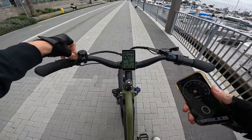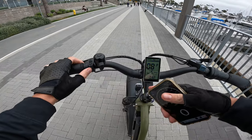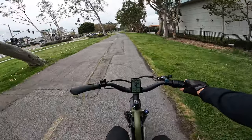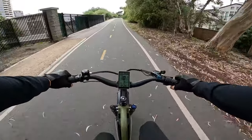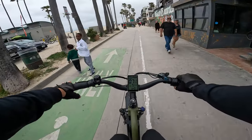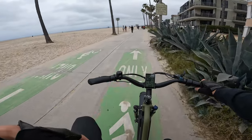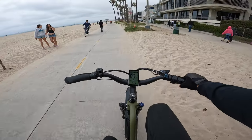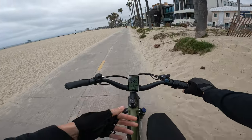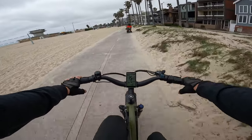Let's unlock the top speed and try out the cadence sensor lag. Pulling up the menu, entering a password, holding down the button to enter, tabbing over to setting 8P. It's set at 32 out of the box — that's not how you change it, so even while pedaling it still cuts off at 20 mph. Testing the cadence sensor lag: not pedaling, then pedaling — power ramps on very slowly. There's a little bit of lag, and the power just ramps on slowly so you can't exactly tell when it's kicking on. We've got a little bit of speed on this thing though.